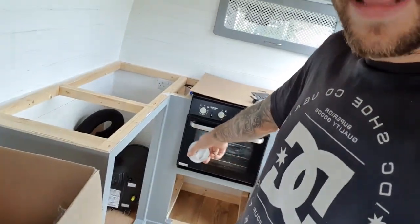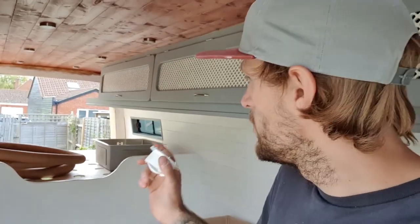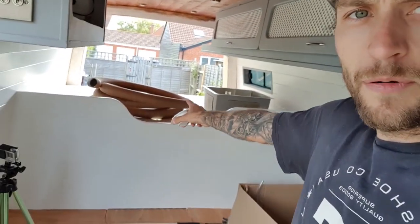I'm going to take one outlet from the combi boiler to each one of these outlet fittings - no joins or splits, each one will be direct. I'm going to put one in the bulkhead of the cab, one in the kitchen area facing in, another one in the living area, and the fourth one will go in this bulkhead facing back into the garage area so the whole van will be heated equally. I'm going to get these holes drilled where they're going to go and then run the pipework where it needs to go. Hopefully once I've done that my gimbal will be charged.